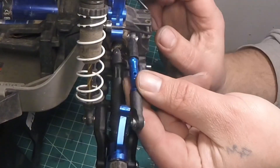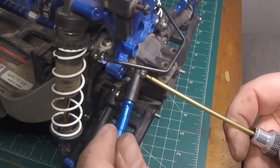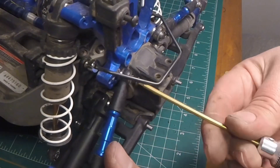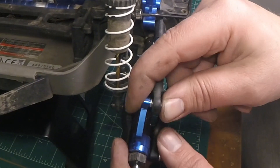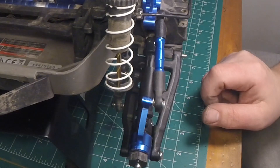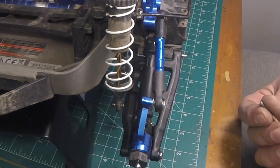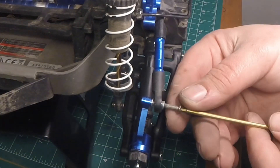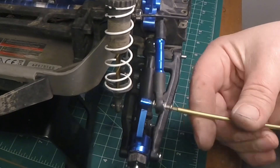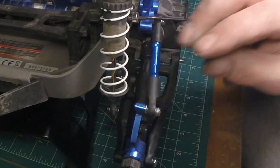The final thing would be a camber link of some sort. This goes back on the back of the shock tower here — I'm going to put it on the farthest in hole. We won't really know until we get the wheels put on how much camber we'll have. If I have to change those arms out for something else, I can. I have some other things we can use if we have to. We're going to try that.